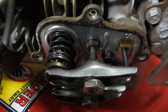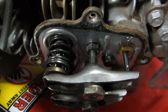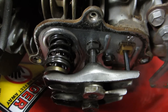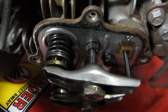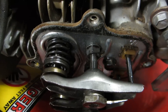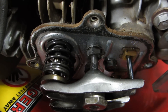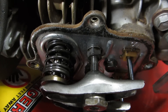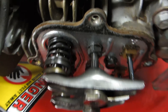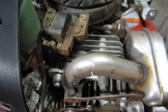You'll see a little bit of a pop of compression release which I wasn't getting before because these things were so loose - that's the reason why it was so difficult to start. Just a little pop right there, and that will make it much easier to pull and give it more power too. Being that they were so far off, I think we've got it all set. We're gonna put the evil twin all back together. This engine is really clean - real happy about that as well.